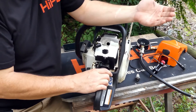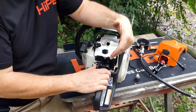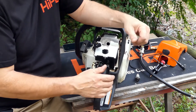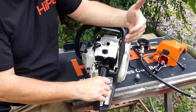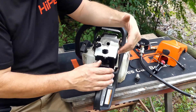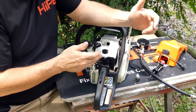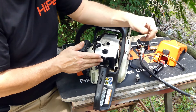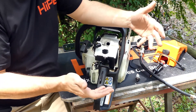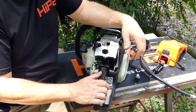The only next thing is going to be the carburetor — is there some blockage in the carburetor? If your machine is a true no-start, in other words it will not fire or make any sound like it wants to start at all, then your best course of action is to either rebuild the carburetor — take it out, clean it — or even better, replace it with a new one. I have a couple of videos on replacing carburetors in similar two-strokes, as well as in a Husqvarna trimmer — you might want to check those out. I'll put some cards up and links in the description. It's actually a very simple job, not that complicated.